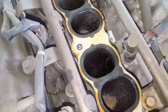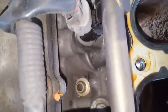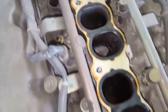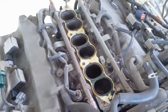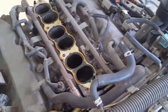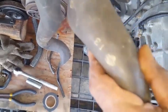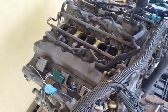Upon investigation, we could see that someone was previously down here, because there's a part over there with a Nissan tag. So this engine was definitely serviced, or this plenum was removed previously. Definitely this engine does not have 35,000 or 40,000 miles. This is more of an 80,000 mile engine. Also, you can notice the hoses are still from Nissan. So that's all evidence. So this is complete, the removal of the intake plenum for the Nissan VQ35DE.